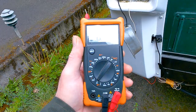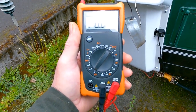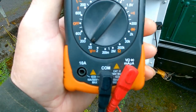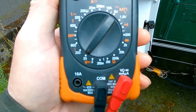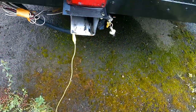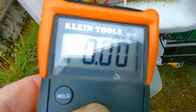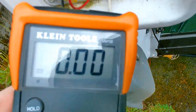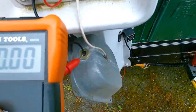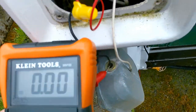I'm next going to test to see if there's any power actually going to the light fixture itself. To test that out, you set your multimeter to the voltage range and put 20 volts, because your battery is 12, so you don't want it any higher than that. Keeping the connection to the chassis there — nothing coming out, nothing coming out. Okay, so we don't have any power coming here. We've got power at the fuse, but not power here.